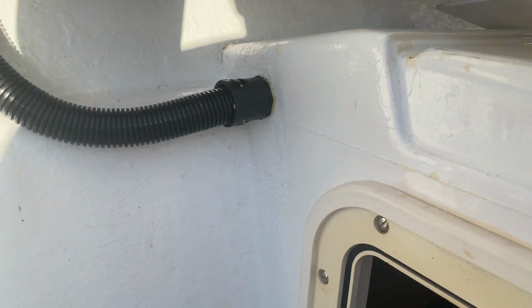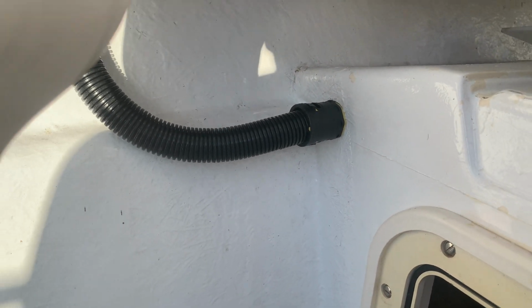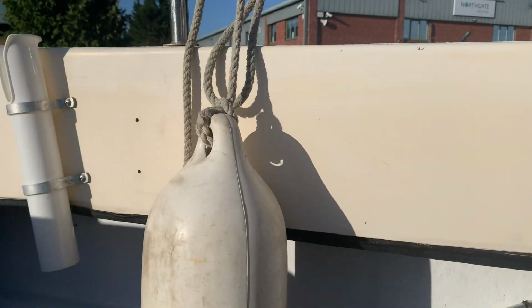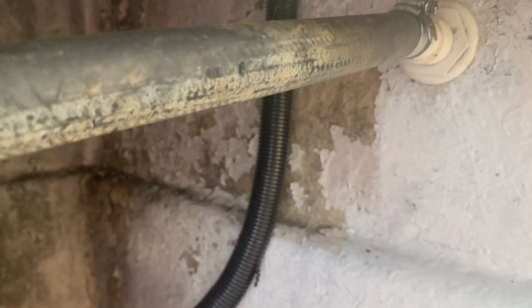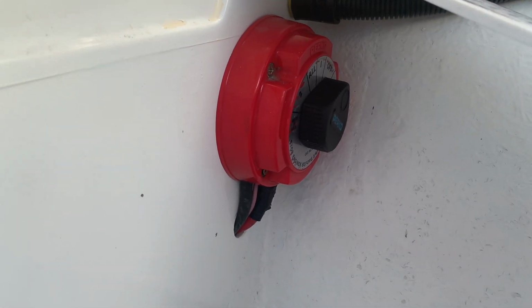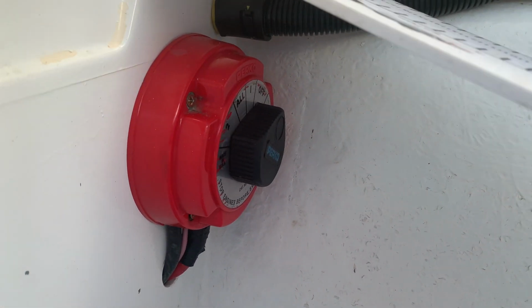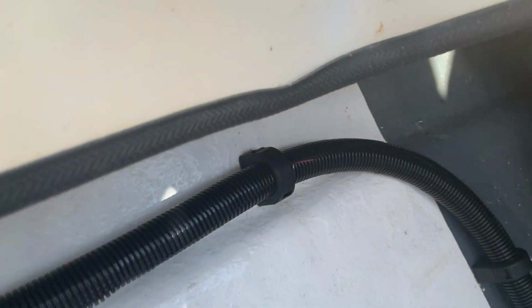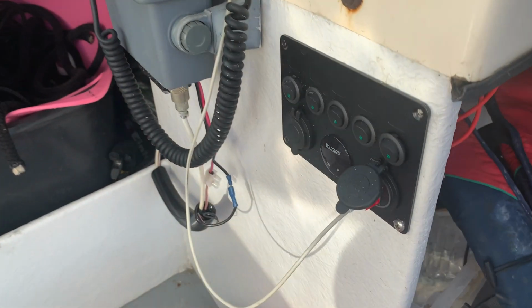And I've used a wiring kit from Rexel, which is an electrical contract supplier, and they do this nice kit. It's all IP65, and I've hidden the wires under there, and then they come back to the engine from there and just nip out and head back into the engine there. I've then moved the isolator switch to the front of the cruise seat, and I've got another bit of piping that comes along there and joins up with the back of the electrical panel.